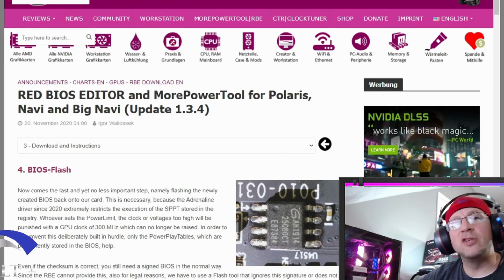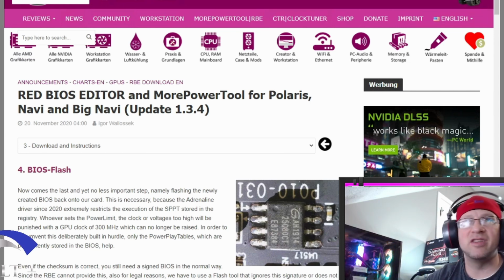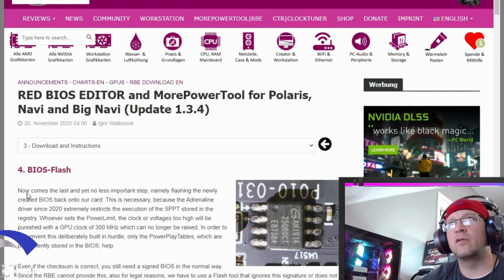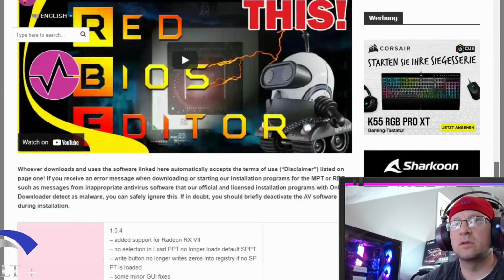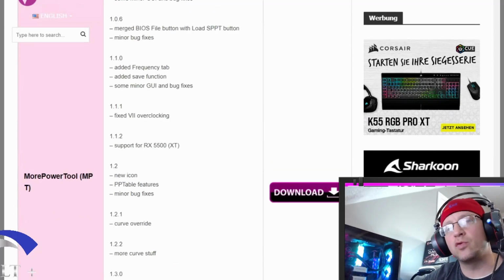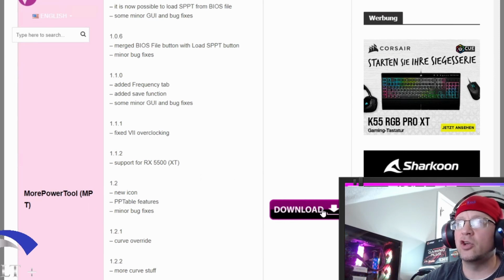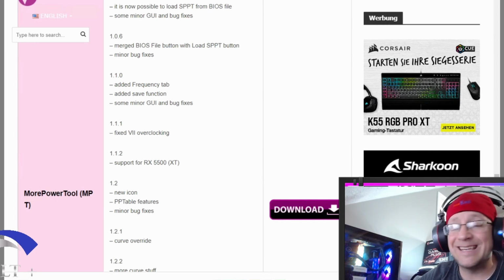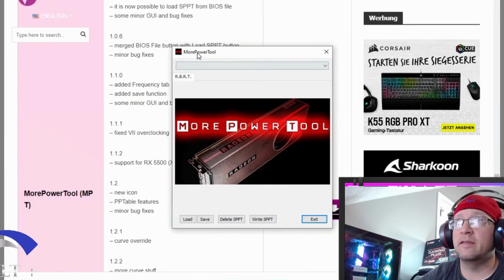Okay, so our next step will be to reduce our power. We'll do this with MorePowerTools, hosted out of Igor's Lab, actually the same way that I have been doing for a long time on the 5700 and 5700 XTs. So I'll put a link down in the description. Just hop over onto this site, scroll all the way down to the links for these tools. If it pops up in German, make sure to select English. This is based out of Germany. So right here, the MorePowerTools MPT, and you're going to want to download. I've already downloaded the new copy. There it is. Go ahead and run it and install it. And then it will pop up like this guy here.